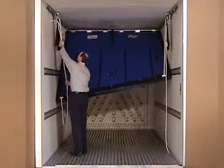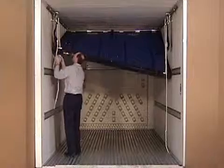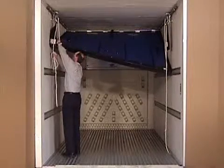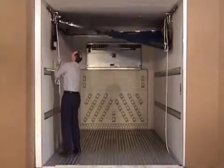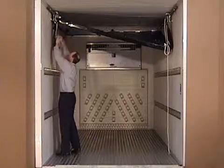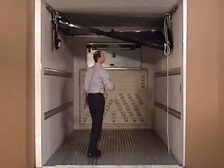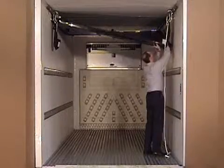From the roadside of the trailer, pull the rope straight down until the bulkhead is 18 to 24 inches from the trailer ceiling. Clip the safety strap on the D-ring. Pull straight down on the rope until the bulkhead is in the highest position. Bundle the rope and put it in the rope bag. Repeat this process on the curb side of the trailer.